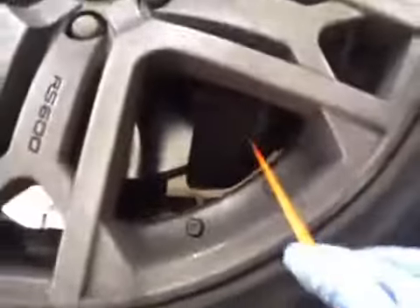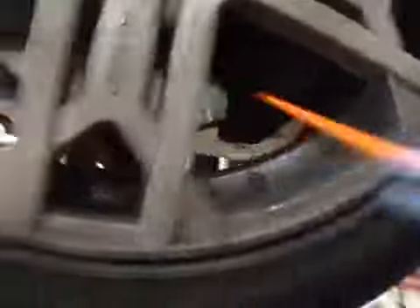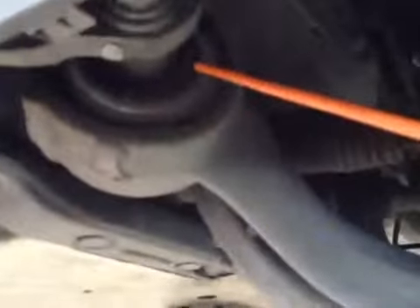The front discs are in OK condition. The front brake pads are roughly on about 6mm, so the passenger side is in amber. The tyres are in amber on the health check. All your passenger side front suspension components all look to be OK. Your front wishbone bushes are pretty badly split here and require replacing.